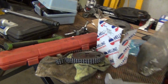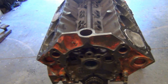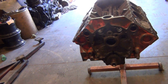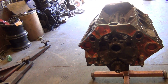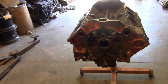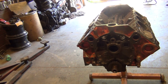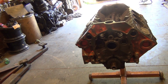All right, timing chain, all that stuff. I got the lower end on, and you can advance or retard the cam. I just usually zero them out. That's what I always do. I have advanced them and I have retarded them, but for a combination like this, I'm gonna leave it zeroed out. I could retard it and close the intake valve point a little later and maybe run 93 on it, but I'm not gonna mess with that. I'm just gonna zero it out and slap her in there, and she should be good to go.